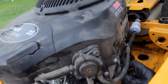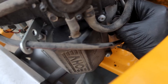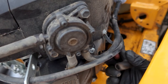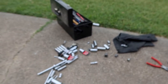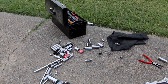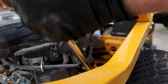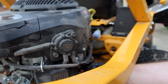Last thing is the spark plugs. There's one on either side — you can see there's one right here. Pop that cable off — there's the spark plug. You got to go back to the pile of sockets you dumped out earlier and find the right one. It is a 5/8 inch, and I'm using this giant breaker bar for no reason at all.